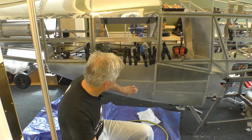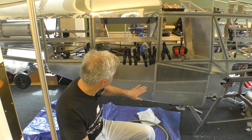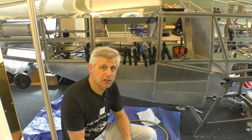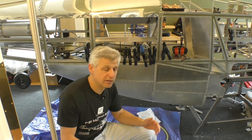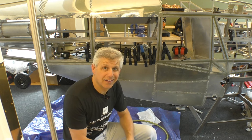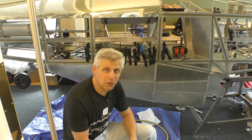This thing is now rock solid, and that's pretty exciting. We chose to go with large flange rivets because we're sandwiching pretty soft and thin fiberglass, and for the long term we wanted to make sure we had a wide surface area — large flange rivets are usually recommended in these cases. This is all going to get painted silver, so they'll blend in well, and our stars and bars will go over that for the D-Day stripes.